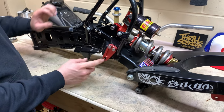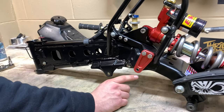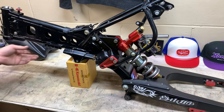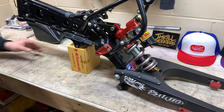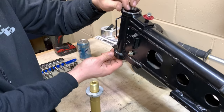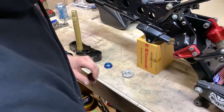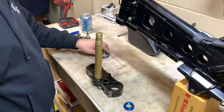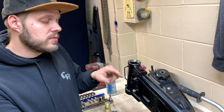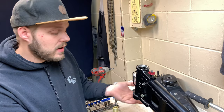The mount is on, and there's actually a motor mount bolt that passes through here which I don't have on hand right now, so we'll leave that for now. To get the bike to stand up so you can build on it, just find something to stick in there and make it work. For the steering stem: I already have the bearing races in the frame — they were in good shape so I left them. I did have to get a new KLX 110 L bearing kit because this has the bigger race. The difference on 2010-and-up versus 2009-and-previous is that 2010-and-up has a bigger lower race, so older bearings won't fit.